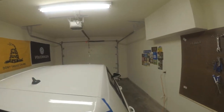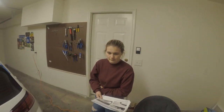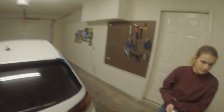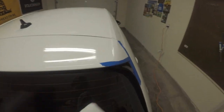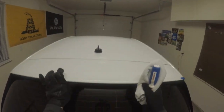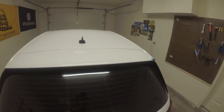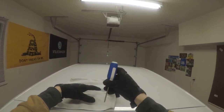So in the directions, it says to cut the glue. The glue is right here. And you just get what I did, I went and got a cheap razor blade that extends really far. Probably didn't need to. And then I just heated it up with a hair dryer and sprayed the blade with quick detailer, and just slid it in there until literally, you could see the blade poking out on this side, and you'll just feel it start to come loose, like that. You'll feel it loose. The next part, I have to get my fingers underneath this to pry it open.